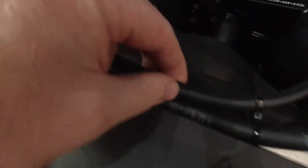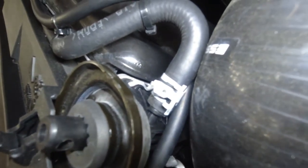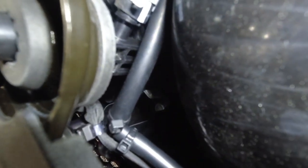The other thing people were asking about was the vacuum line routing. This same line runs up along here with some zip ties and comes under here — there is a T fitting I have installed. With a flashlight you can see the T fitting where the rubber line runs from the supercharger and from the intake manifold down to that T. From the T, one line runs down to the intercooler where the blow-off valve is, one runs up to the intake manifold, and one runs along here and comes up under by the headlight.